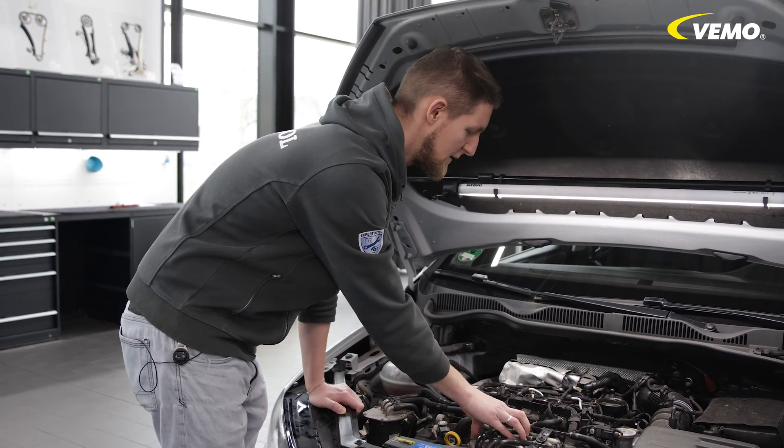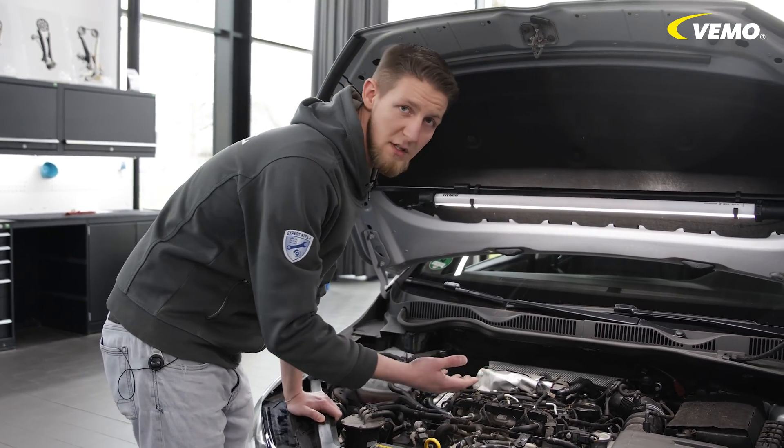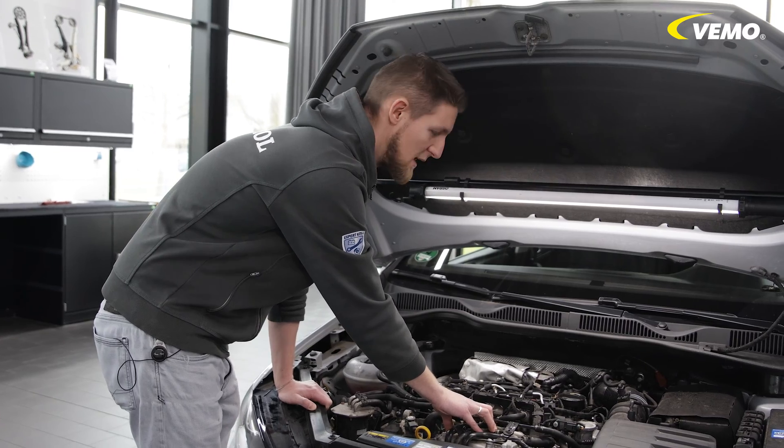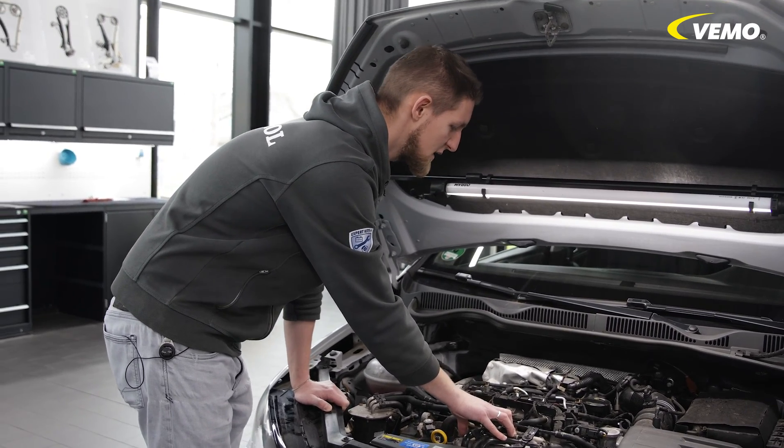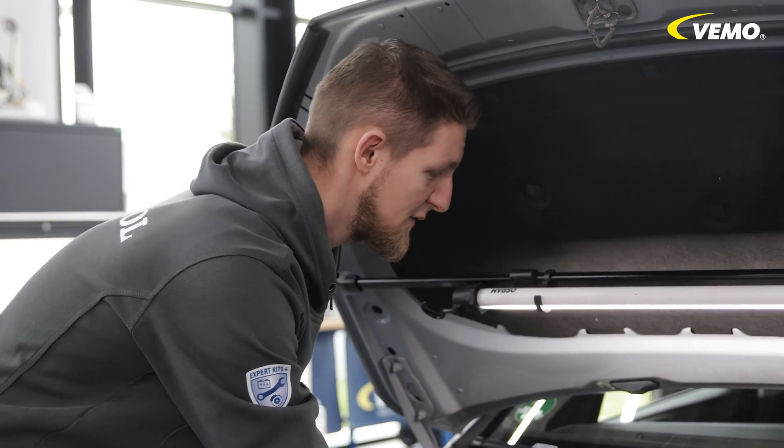So we have a lot of movement in the material and a lot of stress. In these engines, the heat exchanger leaks and there is a gradual loss of cooling water — it starts slowly and increases over time. It often occurs at the fourth cylinder and can actually be easily endoscoped to identify the problem. Another cause, such as a leaking EGR cooler, should also be checked.